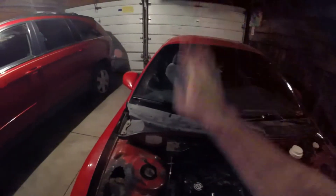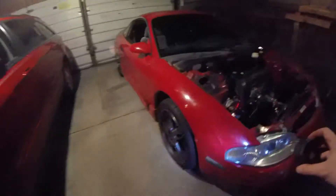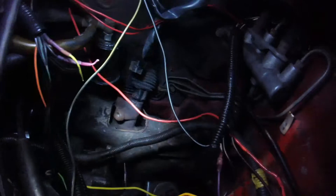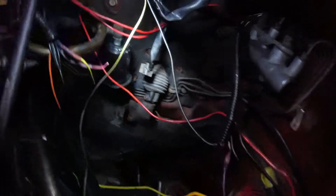Day three - I basically just did what I said I was going to do yesterday and then went to bed. The cruise control box is totally gone - ripped out, cable gone, box gone. I also removed all of the evap stuff from the car - the fresh air canister and all that is completely gone. So clean in there now. There are two open holes on the rack at the moment, and once I get the car driving I'll see if fluid comes out - if not I'll just leave it.